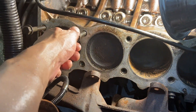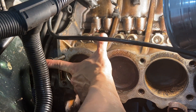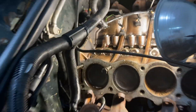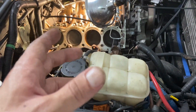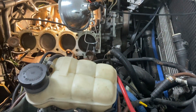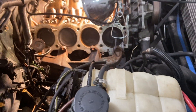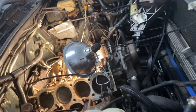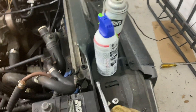I put a bolt in here all the way — make sure it's snug but not too tight, you don't want to mess anything up. Then I did the same on the other side. Visually inspect them, feel them, put something flat on top and make sure they go in about the same way. The other holes might be a little damaged but they still screw on fine. That's a head bolt on my V8 — the only thing keeping my car from being fixed for about six months.